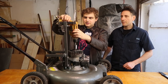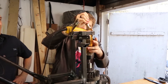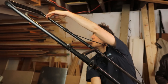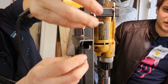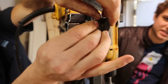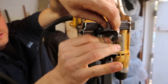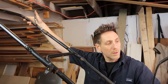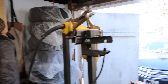Let's stick the drill in here — just like that. This is the throttle, get that lined up. Now let's put the cable — first you release some tension, then put it through here. This is called a cable stop; there's an outer and an inner, and it's very similar to bicycle brakes — an old tried-and-true way of remote articulation. You just pull on it, it unplugs and pops into place. That's it — let's try it out.